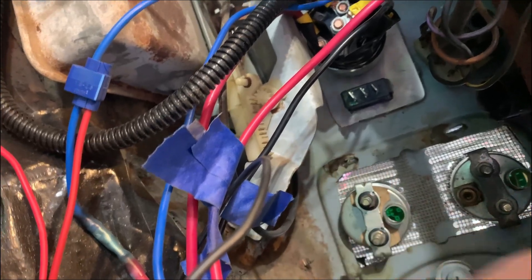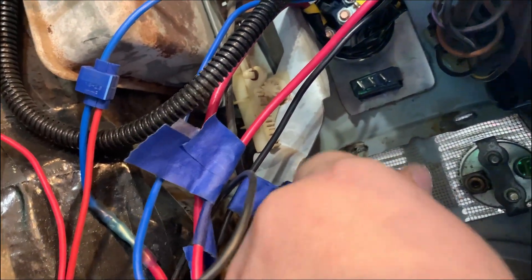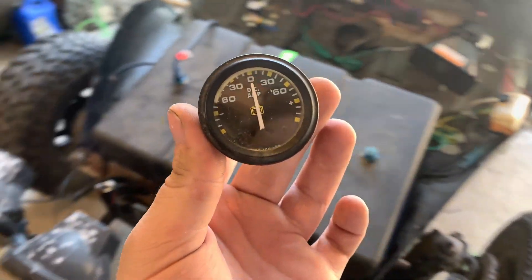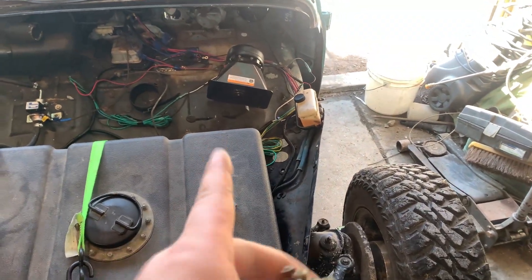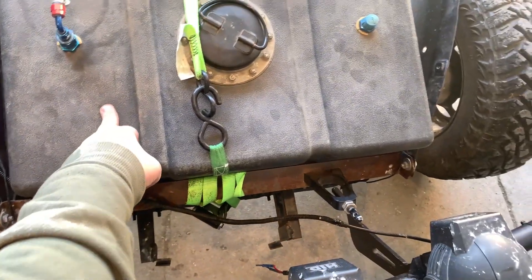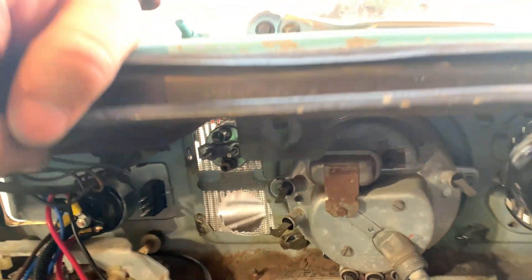Where this panel is, it's gonna be a switch panel with plugs, buttons, and stuff. I'm gonna measure this and replace this slot with one that has a fuel gauge, because I plan on getting a GPS speedometer in here to replace that old one that may not work. I'll get one that has a fuel sending unit so I can get my gas gauge working. I'll take off the speedometer since we're probably not going to use it.